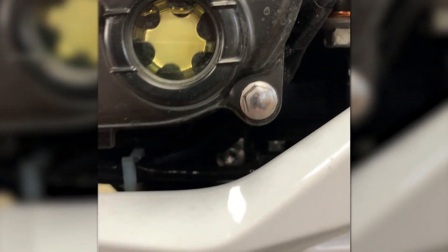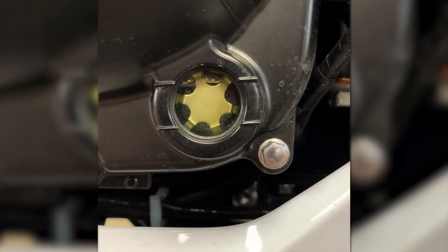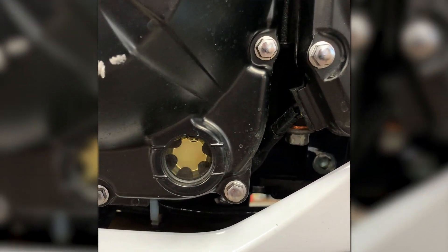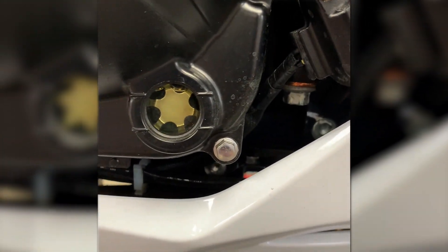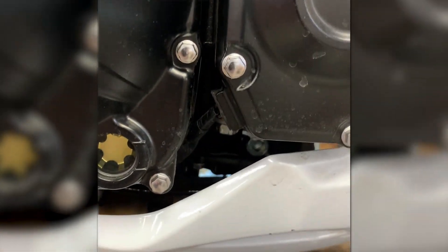You can see there is just the tiniest bit of bubble still there at the top of the sight glass. We have yet to start the bike and circulate the oil, so that is okay. Up until you circulate the oil you obviously don't want to go above that line. The next step will be to start the bike and watch for the oil in this window to disappear, which means the oil is circulating, and then we'll be checking for any leaks.